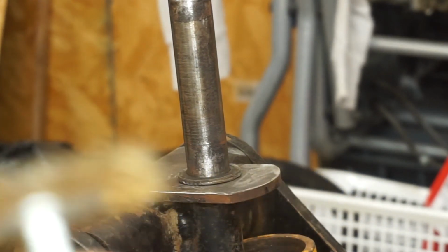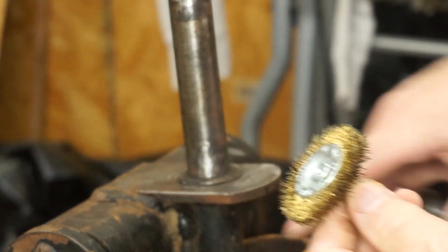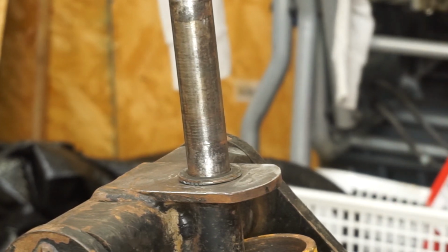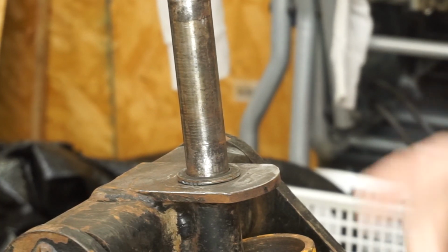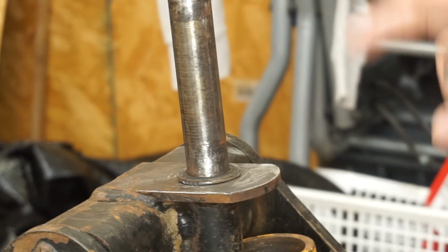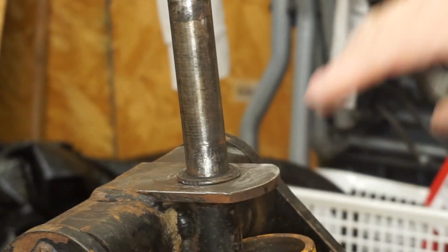If it gets zeroed in on it there. We're going to take this little sucker and we're going to go inside the spindle seat area and clean this up before we put the new bearings in. And after that point, then we're going to go ahead and reinstall the yoke and put the spindle up through the bearings, reassemble it for you. We're not going to put the wheel on because when we end this with the bearings and you get to hear how it sounds, then we're going to start another video on cleaning and sanding and painting these yokes.